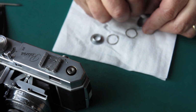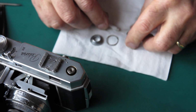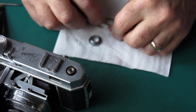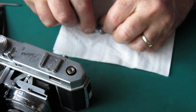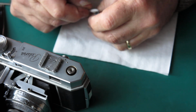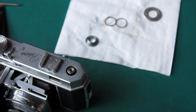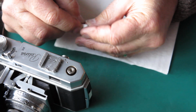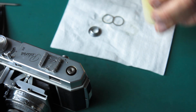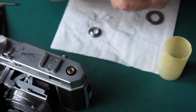They shouldn't require much cleaning because, as I say, someone's had these off in recent times, judging by the unexpected white lithium based grease that had been used. Well, it's tenacious stuff too, doesn't really want to clean away. Okay, so a wipe of synthetic grease on that spring and use that to stick it to its mate.